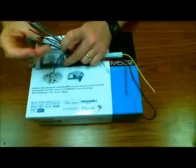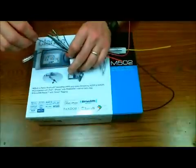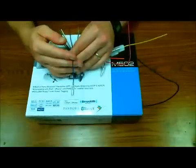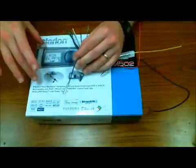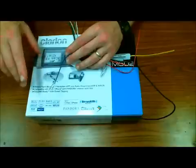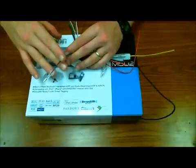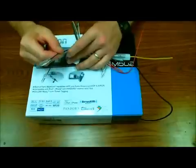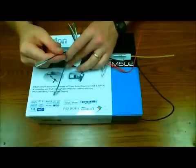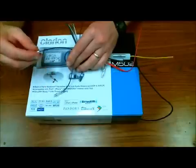You're going to have one or both of these wires: the blue and the blue-white. The blue wire is for a power antenna lead. When your AM/FM receiver is on and you listen to the AM, FM, or HD radio tuner, this wire gets energized to 12 volts and sends power to your power antenna — only when the stereo receiver portion is on. If you confuse this with the blue-white wire and use it as your amp turn-on, your amp would work on the tuner but then go low on disc, Bluetooth, satellite, or any other source, and you'd think your radio is bad when in fact you just didn't wire it right.